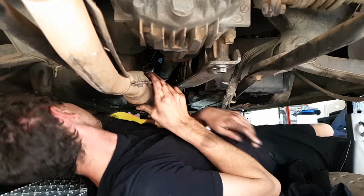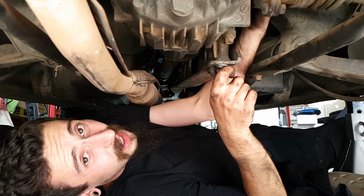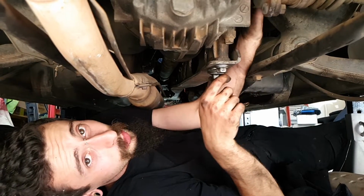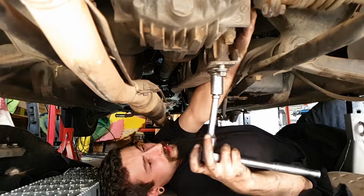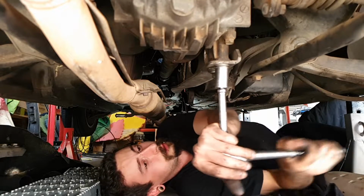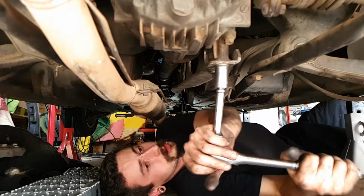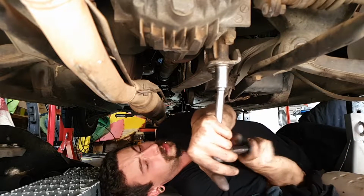I'm just going to grab the nut. And instead of me pushing those mushrooms in, I'll let the thread pull it in, you know what I mean? I shouldn't probably tighten this up. I might tighten it up and then loosen it off, so I've still got movement in it that I can line up the gearbox. Ooh. Yeah, this ratchet's broken.